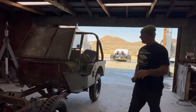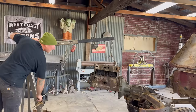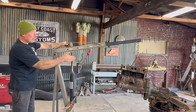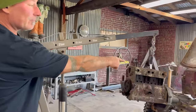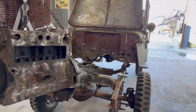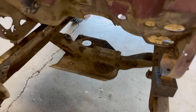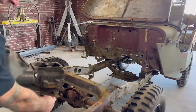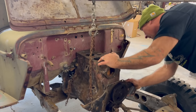But that's not what we're here to talk about — we're here to talk about putting this engine in. It had the Toyota engine swap, so all the mounts have been removed to fit that style engine. Fortunately, the transmission — if you look way down in there, you can see those two little studs poking up all the way at the cross member. They index on these right here, so that is stock, and that's why we know that's where it goes back in place.